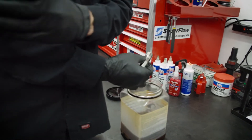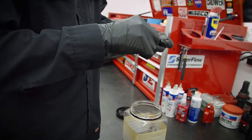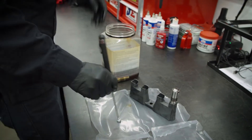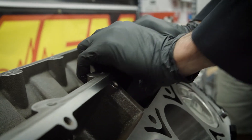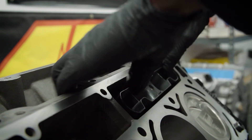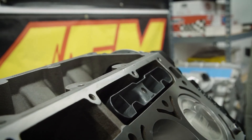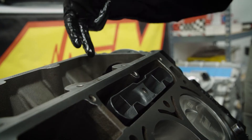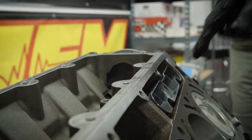So I know that that's going to be facing that way, so we're going to do that and we'll go on like that. I just like to stage them up like that. That's in, and the lifters are right now in the up position, so they're not actually touching the camshaft just yet. Once you have a push rod in there, you can push them down into place.